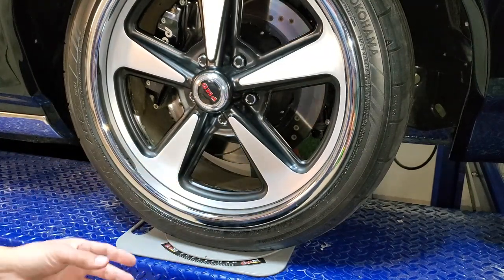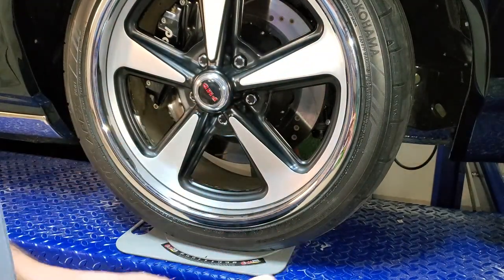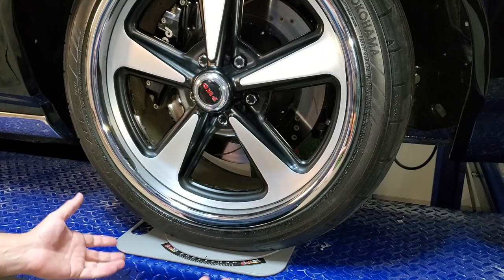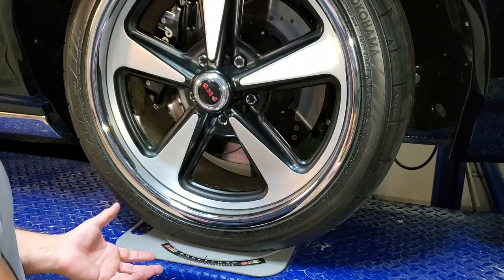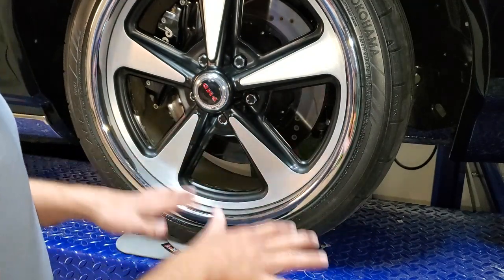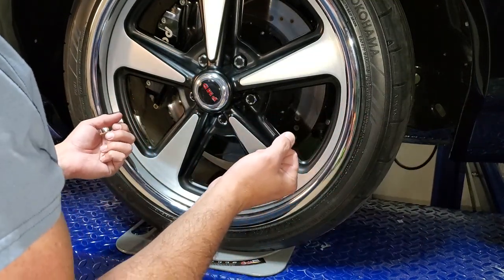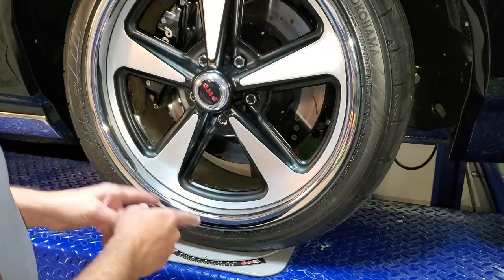Get yourself some if you can. Plan B: if you don't want swivel plates and you're on a flat garage floor, you can use trash bags — roll onto them. If you pick up the car and put the bags underneath, make sure your suspension is fully loaded for an accurate toe reading. I'd recommend just driving onto them for a little more freedom of movement. But swivel plates are by far the best method.